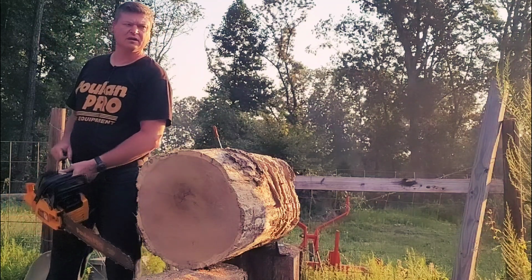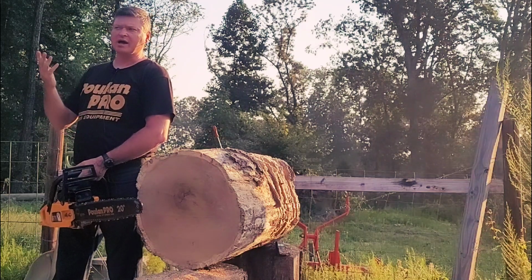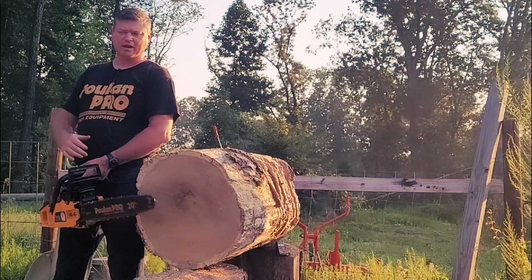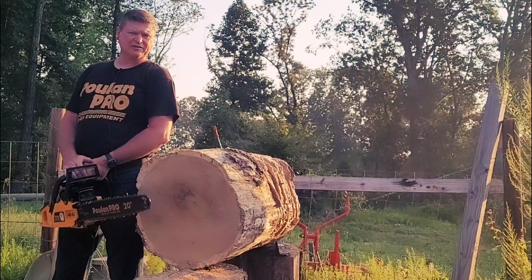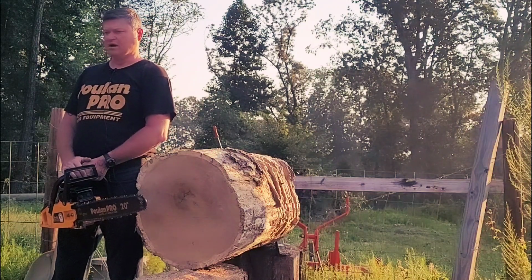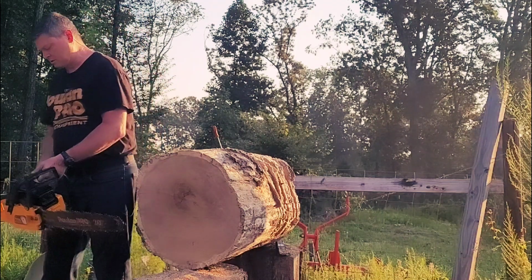Oh, and I cut the squish. I cut a lot out of the squish. I don't know how much, just cut out enough to get my numbers. Probably about 40 or 50 thousandths, something like that. Maybe 30, I don't know. But ultimately my squish is at 22 thousandths.